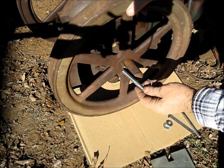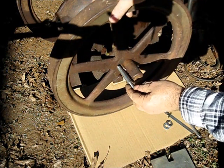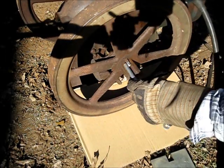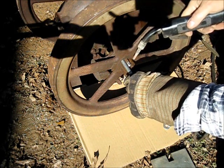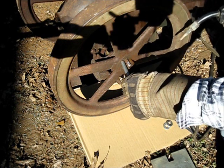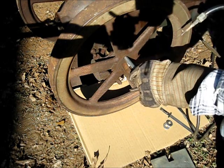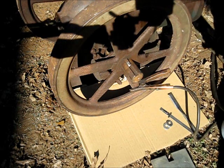To get on with this Gib key - that's just the bolt I cut off, I think that's a 7/16. And what I'm going to do, I'm going to weld it on there. There is a question: should I put it on the side and put a bead down through there? Well, I think not. That's only about one inch of key I've got sticking out there. This one was tight, really tight. So I think I'm going to run two beads, one on each side. That'll give me more support, I'm thinking.